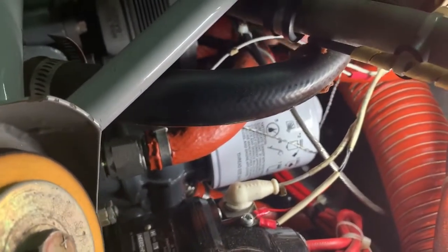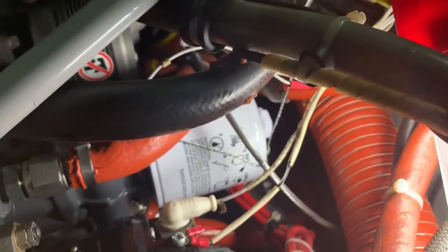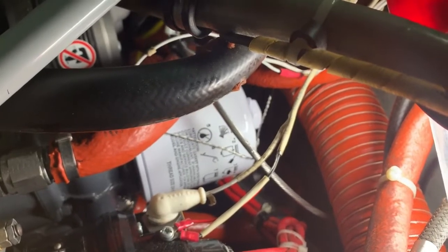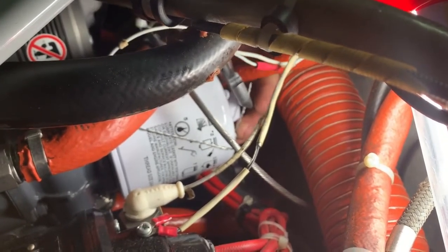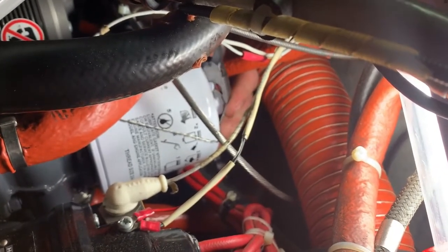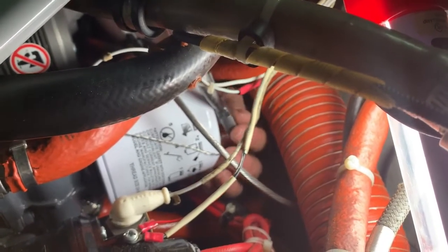When you release it you might see it's a little loose — you can always pull it up and twist a little more to get it tighter. What I'm going to do is cut my extra chunk off and put it somewhere safe so it doesn't end up down in the engine bay. Sometimes you can get in there and give it another little twist — easier said than done to get it really tight-tight. Just make sure you don't twist too much or you'll break the safety wire and have to start again.